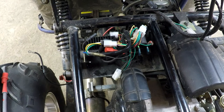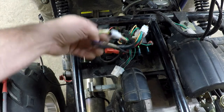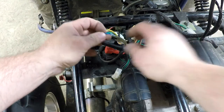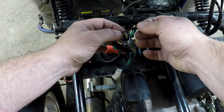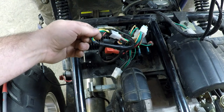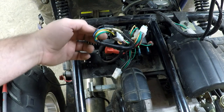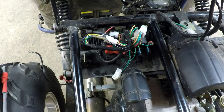My next step will be to find out which wire is the pickup coil that goes to the CDI plug. Those wires here — this one will be the stator. I have a blue-white and a black-red here. So I need to identify those wires on the right side of the engine to see which one is the pickup coil.